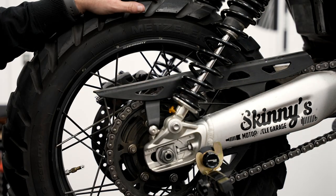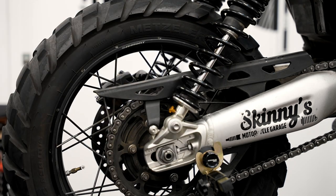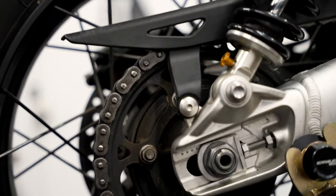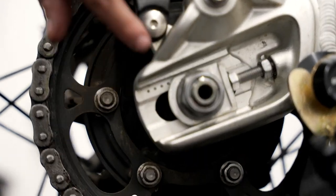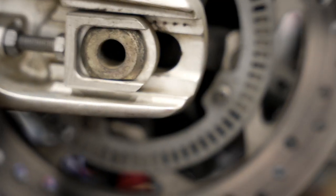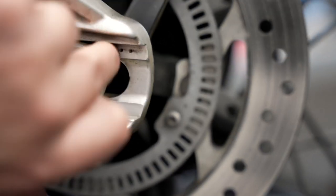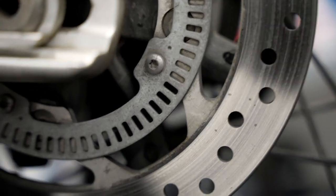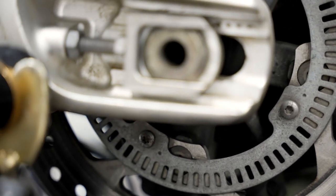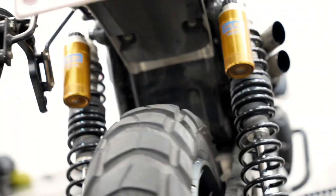Now that I've adjusted this side, I look closely at the dot and see it's just touching the fourth dot. So I'm going to go around to the other side and try to get the same spot there. It's a bit dirty but you'll notice it's a bit of a ways off that dot. So I'm just going to make it match the other side — and that's it. That's literally chain tension 101.